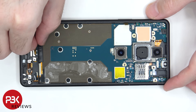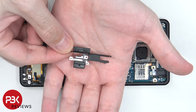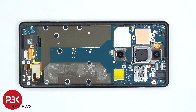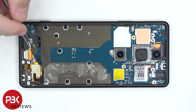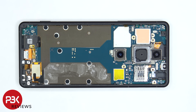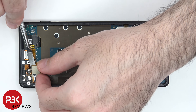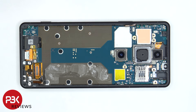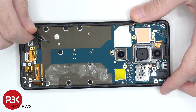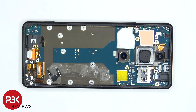There's yet another plastic cover which needs to be removed. Once that's removed we have access to the screen cable. There are two adhesive strips on either side of the screen cable, so we're going to have to gently pry that off when disconnecting it. Underneath these black circle stickers there are screws — in total there are nine Phillips screws which need to be removed. Finally once those are removed we can lift up and remove the main board.